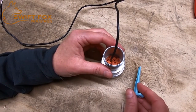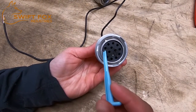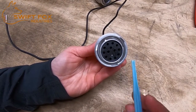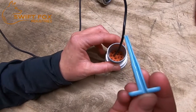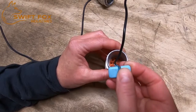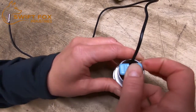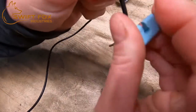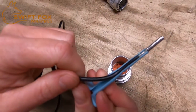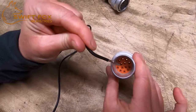What's more common is you'll get a skid steer attachment with an electrical plug where the pins will be in the wrong spot to match your machine. You can easily fix this by using a pin removal tool. You just slide that down beside the wire and it unlocks the pin, allowing you to pull the pin out. Then you can move it to the right pin location to match your machine.